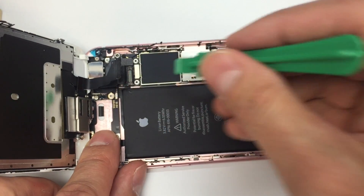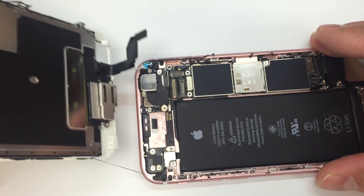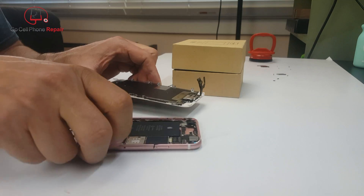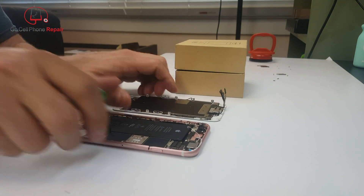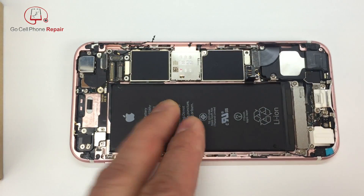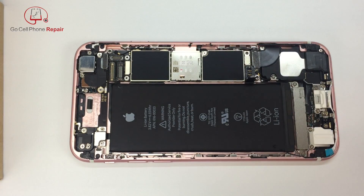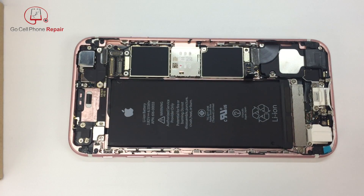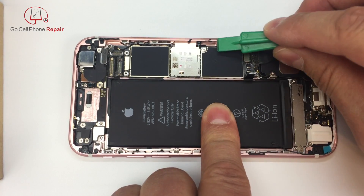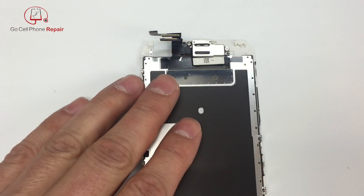There are three cables in total. Once you have them all unplugged, you'll still have to pull against the adhesive at the top end of the phone, but don't worry about that because we are going to replace it when we put the new screen in. You can see here that I'm removing all of the residual adhesive. What you can't peel off you can usually scrape with a very soft pry tool — the same tool we used to open the phone can be used here very carefully along the edges. Make sure you don't rub against anything on the inside of the frame.